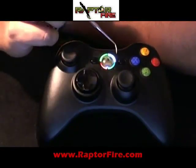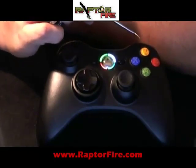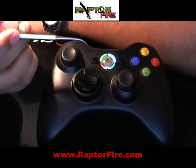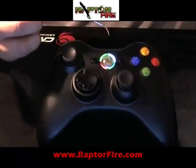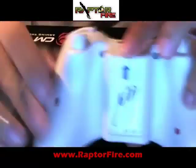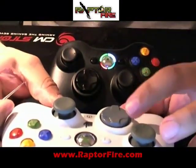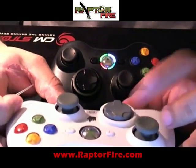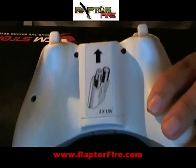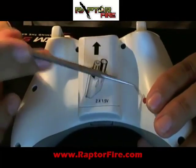The instructions call it light blue. I know that option is for the right bumper — that's for the Gears of War active reloads. So if the customer wants the Gears of War active reloads, you hit yes or no. I want to stress out: if they do want this option, we have to install the optional button. It's not recommended without it because otherwise you'll keep hitting the D-pad to cycle through modes and accidentally switch weapons in the game. So if you give the customer the active reload option, go ahead and install the button — it makes it a lot easier.